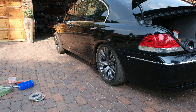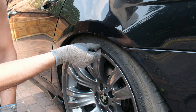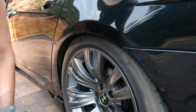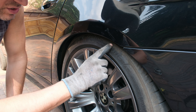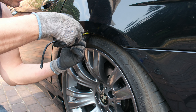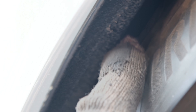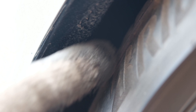I haven't got a wheel spacer installed yet - this is stock standard. I'm trying to ascertain how much space I'll be able to create to put a spacer there, so I can decide what spacer to put on this vehicle. I can get my fingers in here - it's a little snug towards the back. I'm measuring from the side wall of the tire to where the wheel arch steel is sitting - that's just over one centimeter of clearance. If the steel scratches the side wall it can slit the tire.